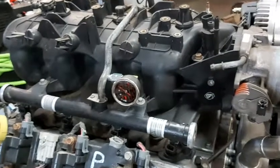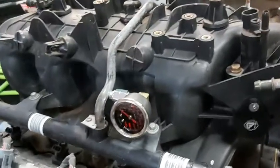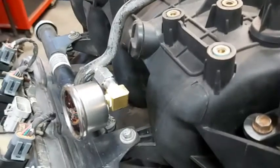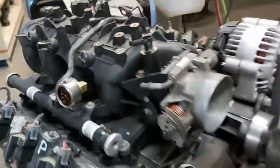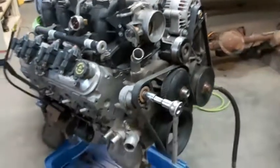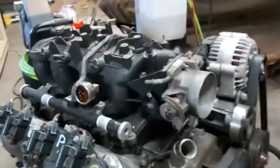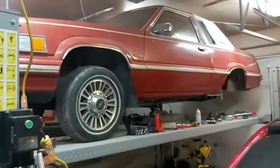Here's a close-up shot of the fuel pressure gauge with a fitting and the 90-degree elbow fitting attached to the factory fuel rail. This is a factory truck intake — this whole engine is a 6-liter from a truck. I just wanted to see how cheap I could do this turbo charge going into that Ford right there — Fox body 1980 Thunderbird.